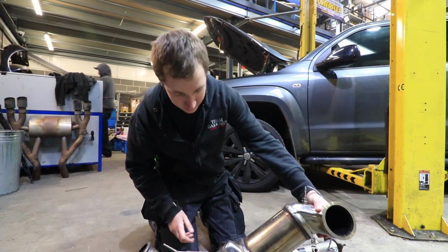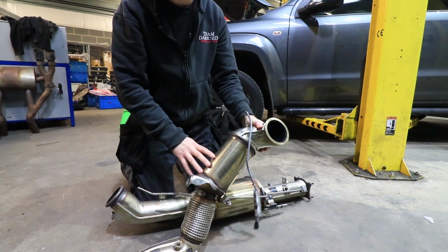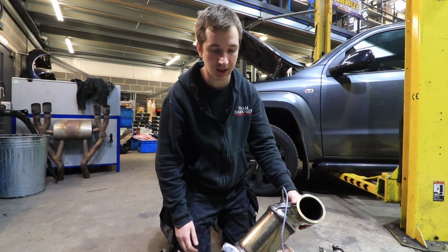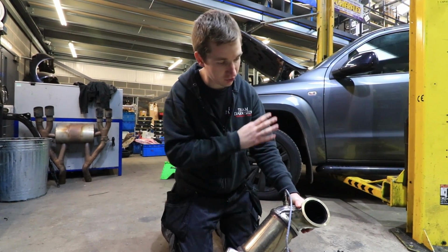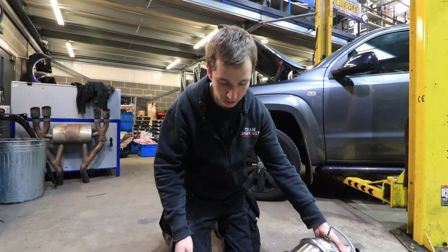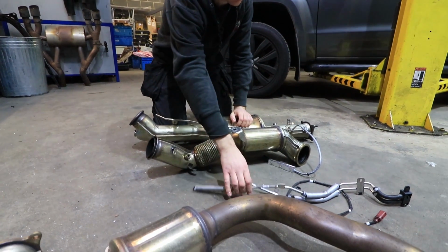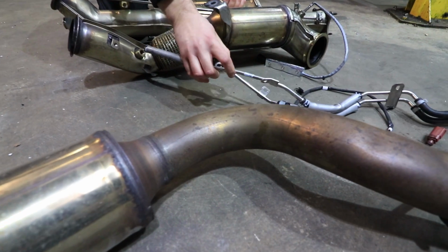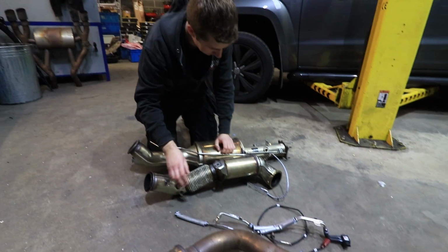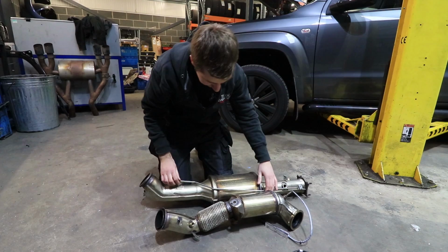But anyway, there's a couple of sensors that we need to put into this later one, because when we've gone onto our parts system, they've not actually had anything for this truck, because it's so new. We're missing a couple of bosses that we need to put on, and I potentially want to put the pressure sensor bosses on because they do cause people some problems, but it is quite hard usually to make these fit, because we'd have to run a pipe all the way from there to the right up the top here.